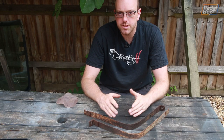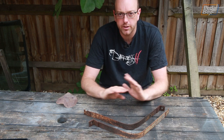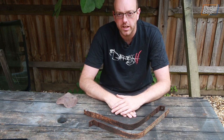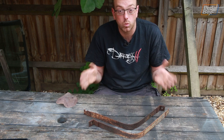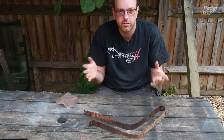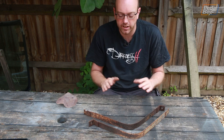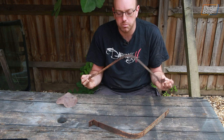Overall the tank is in pretty good condition. It's a little bit rusty on the outside but we've wiped all of that down with some sandpaper, got rid of all the crustiness, and coated it with some cold galv spray, so hopefully that should stop it rusting any further. At least we know it holds liquid — it had nearly four gallons of fuel in it, albeit very very brown and varnishy.